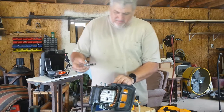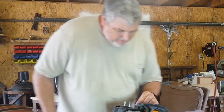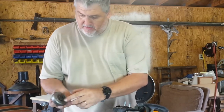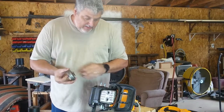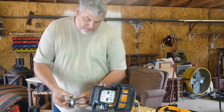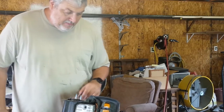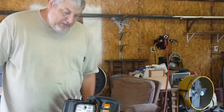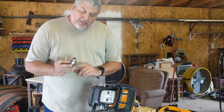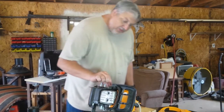I'm sure everything in here is going to be fine, but I just wanted to make sure it all looks good. I wanted to check these back teeth because the chain did get caught in here and kind of tore things up, so I was expecting to see damage on the flywheel — we've had that happen on a lawnmower before. But it didn't do anything to it. Took this off and checked it out and it looks in pretty good condition too. So now I'm going to see what else it might be.